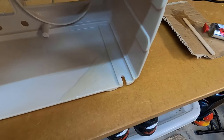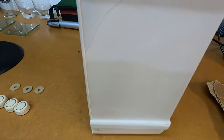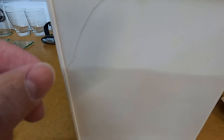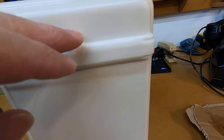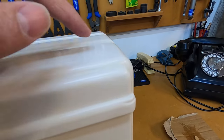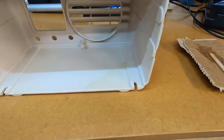I've put a layer of epoxy glue along that crack and worked the glue into the crack. If we turn this on its side — I don't know how well this will show on camera — but the glue has worked through the crack. You can see it on this end, and having a closer look, the glue has actually seeped through the crack up here too. Further up, I've just layered over that crack, which should add a little bit of strength to prevent it spreading up the side of the casing. I'm just going to let this sit overnight and harden.